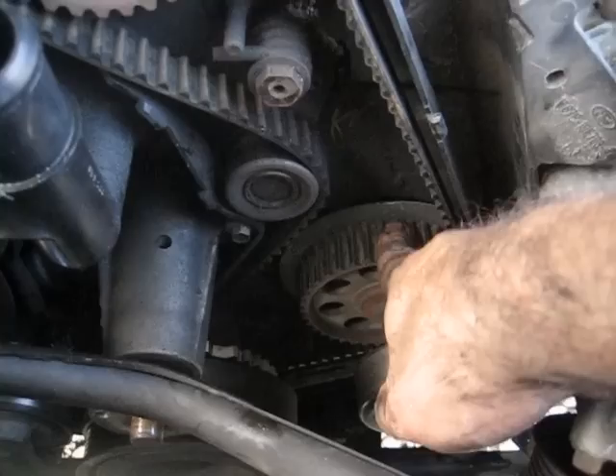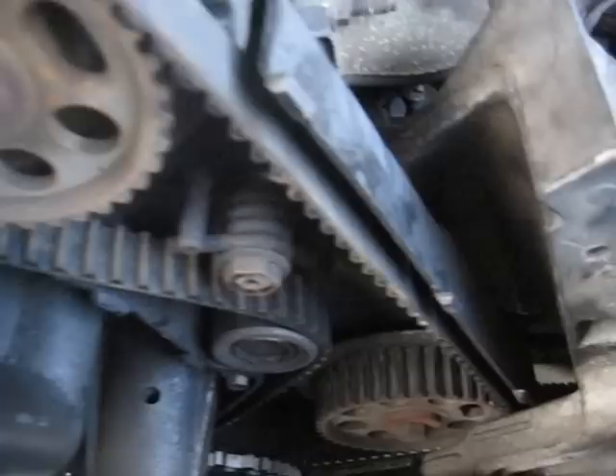I'm about to take the belt off. That diamond mark right there on your camshaft has to be straight up. There's an arrow mark down here that lines up with an arrow mark on the camshaft. Down here on your oil pump, there's a corresponding diamond - those must be straight. The best way to do it is to take out your number one spark plug on the driver's side and look down in the hole. You can see your pistons all the way up, which means you're centered and you're in time. To get the belt loose, that's a 17 millimeter - back it out two complete turns.